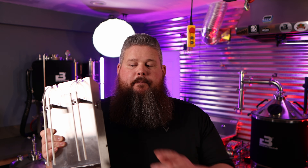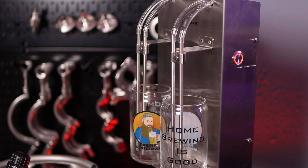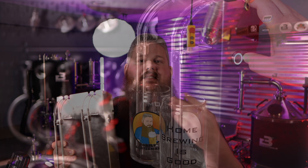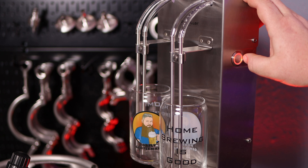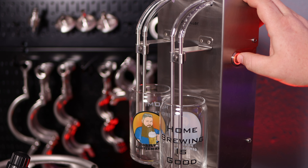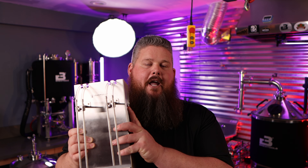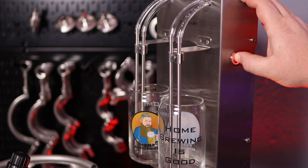If you should want to go into CO2 programming mode, it's really simple. You hold down either of the buttons for six seconds. After six seconds, the light's going to change color — you're now in programming mode. Each depression of the button is one second advance. It'll flash red or orange and green every second. When it gets to 10 seconds, it restarts and stays solid blue. So then you push it five more times — it's going to stay green. Push it another time and it flashes back to the orange color, and then you're at six seconds, the ideal fill. To save that, just hold down either of the buttons for around six to seven seconds and it's saved in hard memory — it will not delete that setting if unplugged.